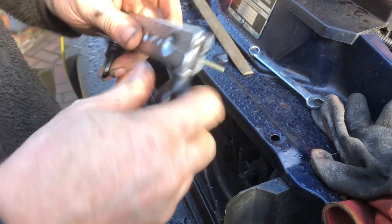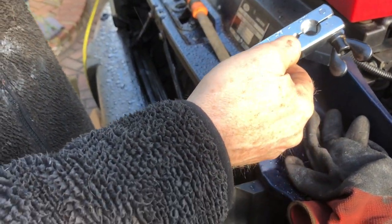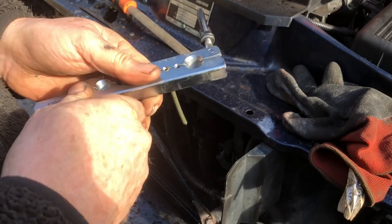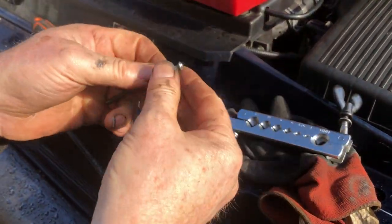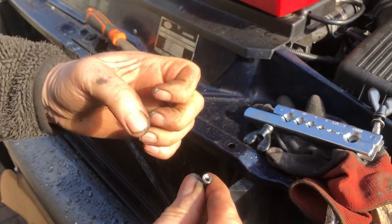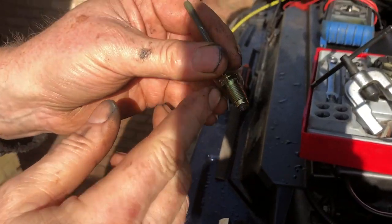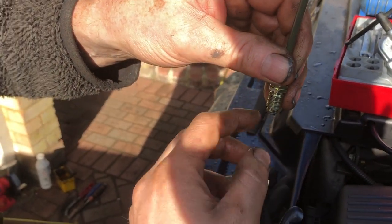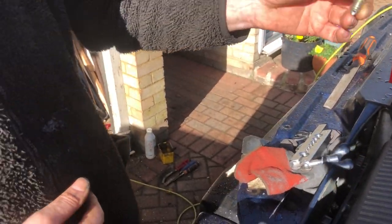You can see where you've done that - it's changed the shape. You'll need your spanner to undo that again. It is helpful to have a vice as well. If you don't tighten this up enough with the spanner that's designed for those lugs, you'll find that when you're pressing your flare it floats through the top. That's how we did ours - it's not the most perfect one because we're doing it in our hand not a vice, but if you're in a vice you can push down properly. The union gives you more area to push down on, and that just squishes in and creates your seal. It's not the thread that creates the seal - it's the actual flare. The thread just puts pressure onto the seat.